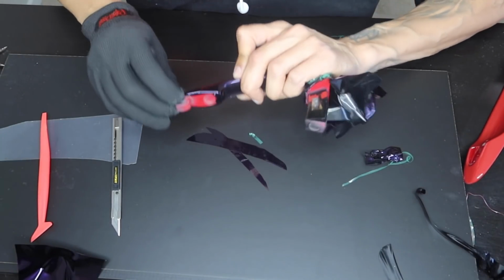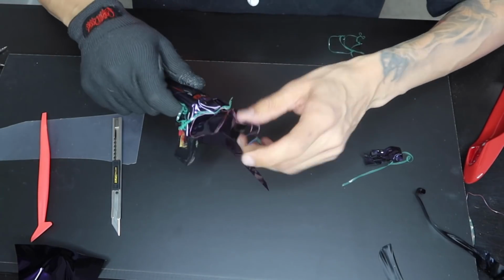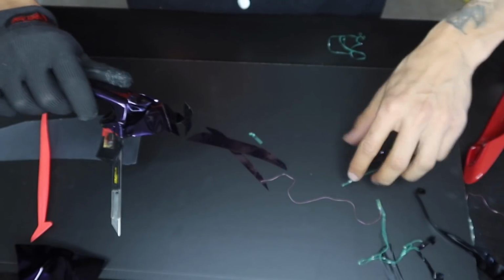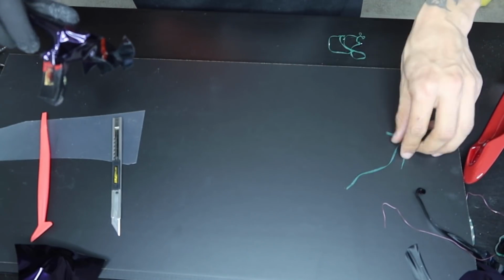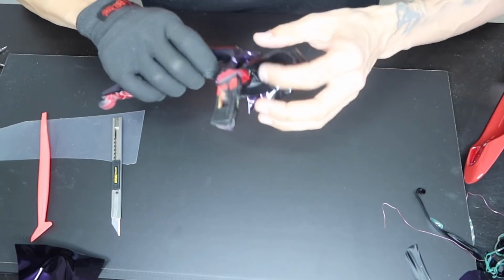And that corner's looking perfect. Nothing's lifting, nothing like that. So now that this side's done, we're able to go ahead and work this edge. You guys can see the knifeless tape is kind of a pain in the ass if you leave it around. So you want to make sure the area of your surface is clean, so that this way the vinyl doesn't attract any of the debris or any of the remaining knifeless tape.